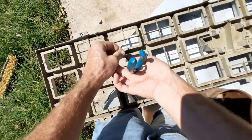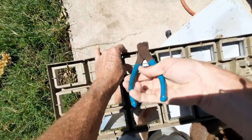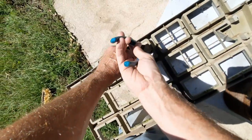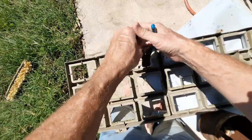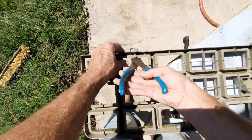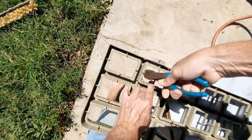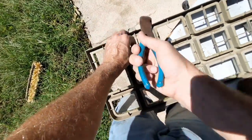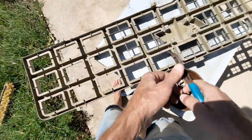One of the main reasons why I'm doing this is so I can get to the horn wire, to pull the horn wire, so I can work on the horn without pulling the damn grill off like I did last time. And you're asking, well, why didn't I just pull the horn relay? Well, if I'd have pulled the horn relay last night to fix the horn, then I would not have been able to hear the relay clicking to know if the horn is functioning correctly or not without the horn going off. And yeah, then I could have pulled the horn relay and then hooked up a 12-volt light and done all that stuff to chase that down.